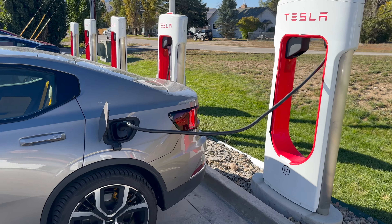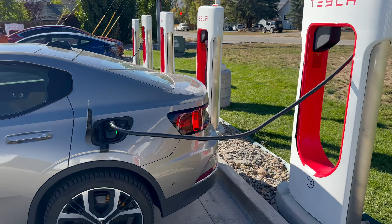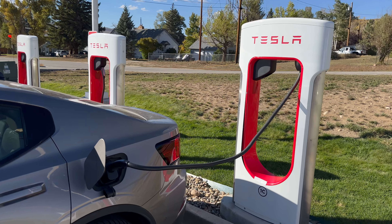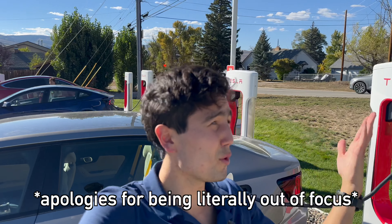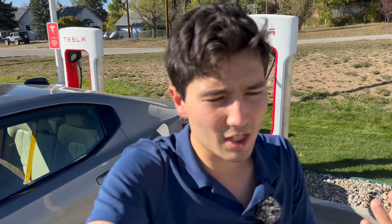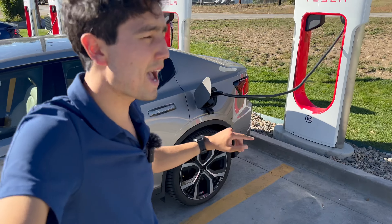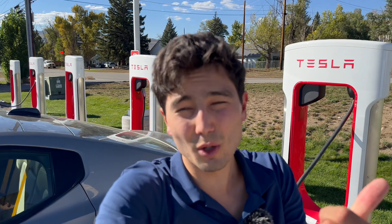One other downside — it doesn't apply so much to my Polestar 2, but to many other vehicles — is the fact that Tesla Superchargers are not high voltage. Vehicles like the Hyundai Ioniq 5 and Lucid Air have 800 volts, meaning they charge quickly, up to 350 kilowatts. Some Tesla sites can do 250 kilowatts, so you'd think they could charge those cars at a decent speed. But that's not the case because these Tesla chargers are not 800 volt. The vehicles do have a built-in booster to step up the voltage, but depending on the spec of that booster, they may not charge at full speed. The Lucid Air, for instance, is only able to charge at 50 kilowatts with its booster.